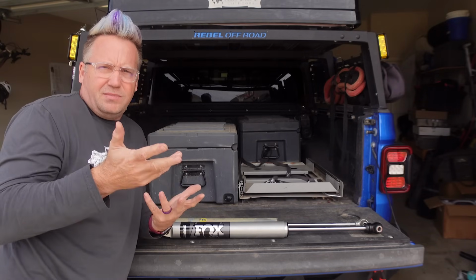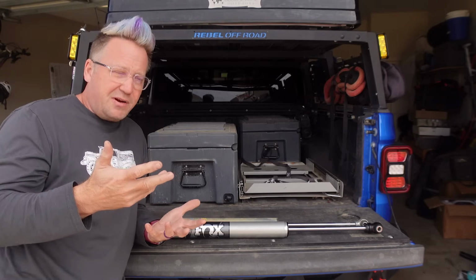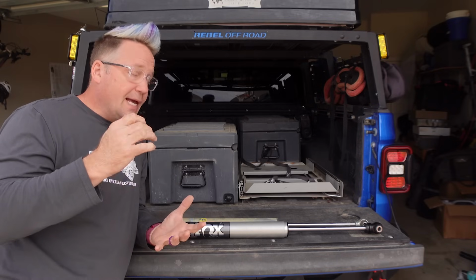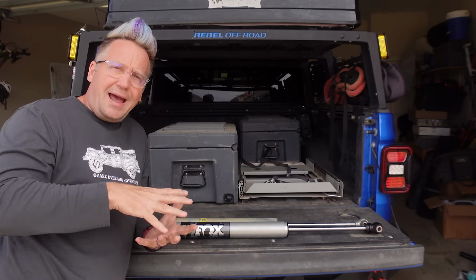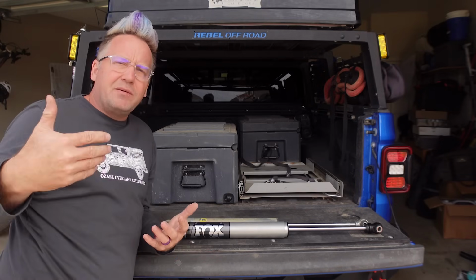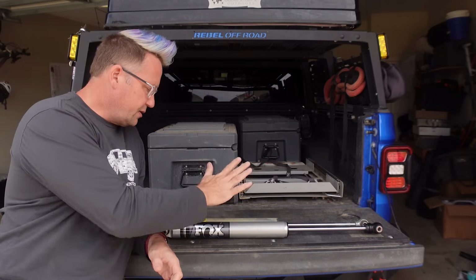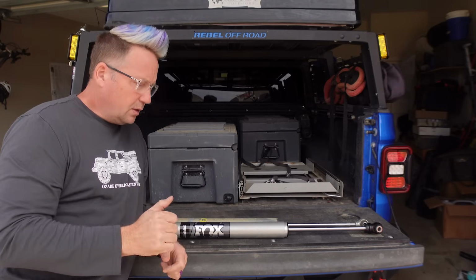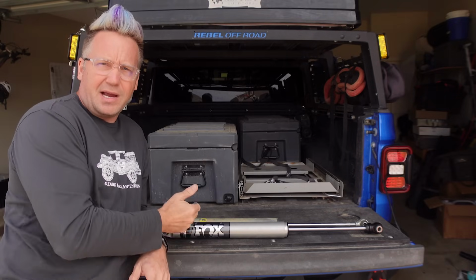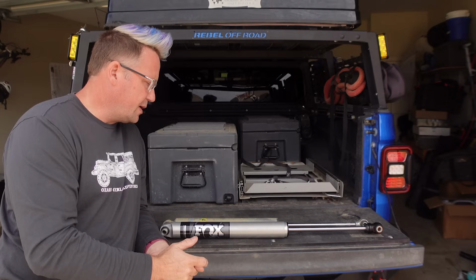spring dampener, and I may be using the wrong terms here. I know the concept, just maybe not how to word it correctly. The progressive coils have a lot more stretch to them, and so I can run a longer shock, giving me a lot more articulation with a smaller lift with the progressive coil than I can with this standard coil. So that's why I am using longer shocks than what you would typically run with a 3-inch lift.